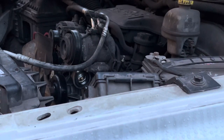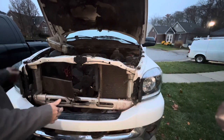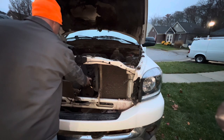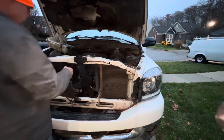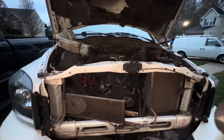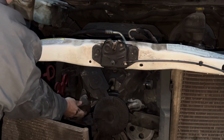Make sure your surfaces are nice and clean, then install the housing. You could at this point put your serpentine belt on, but if you get any little bit of antifreeze on it — just one drop — it's going to squeal and make all kinds of noise. So I'm going to wait and do it last, but I am going to go ahead and put my tensioner on. It just takes a 15mm bolt and you want to make sure you get those nubs lined up.